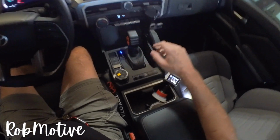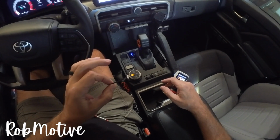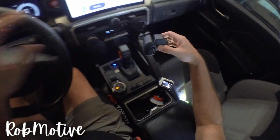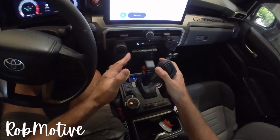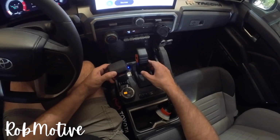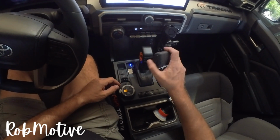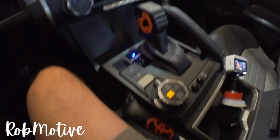That's awesome. Now, for peace of mind, for me, for a little bit anyway, I'm going to keep the set screw tool, the Allen key, in the glove box here, in case I wanted to remove that for some reason. And then I'll also keep the original shift knob in here, just in case something goes wrong. You know, you get something new, you want to test it out. That way, you saw how easily it is to remove. I could just turn the two set screws, pull it off, put the other one back on, snap it up, and I would be good to go. Pretty cool. I dig it. You guys will have to leave a comment. Let me know what you think.